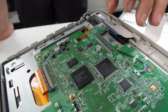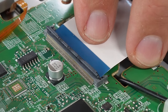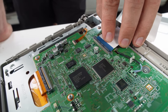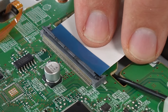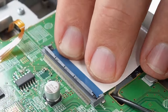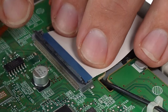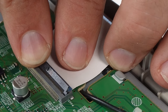This is the most delicate part of the whole operation. You've got to make sure the cable is laying really straight on top of the correct pins when you insert it. If it's crooked or one pin over, you could destroy the whole thing. Make sure it goes in really smooth — wiggle it, make sure there's no resistance. The cable has to sit in between those gray plastic pins, not on top of them. Then while holding pressure into the plug, lay it down and click it into place.